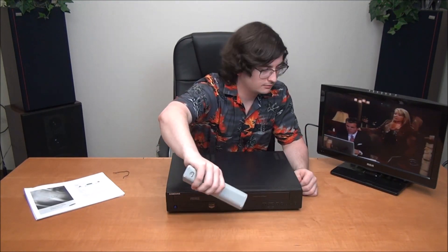Everything you see here is what is being recorded onto the DVD. The recording will stop when you either push the stop button on the remote or when the disc is full. I'll go over in a moment how you know when the disc is full and how to adjust the settings on it. It is now stopping and saving all the information to the disc. Once it's done, we can finalize it — and you definitely need to finalize the disc. If you do not finalize it, it's not going to play back in other devices.